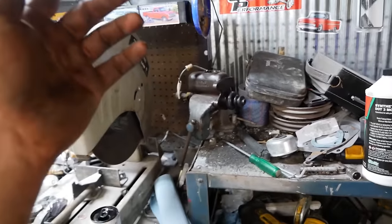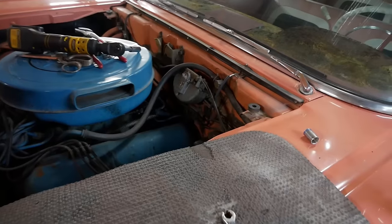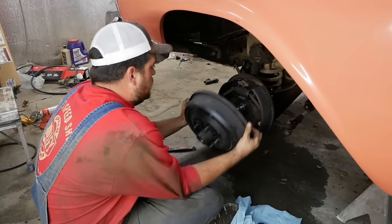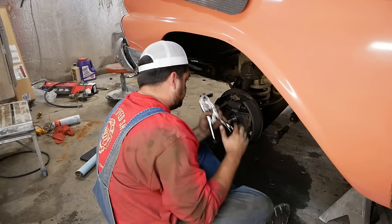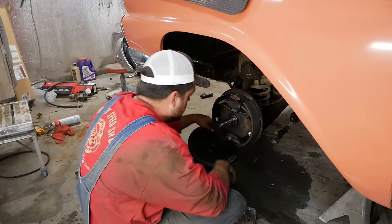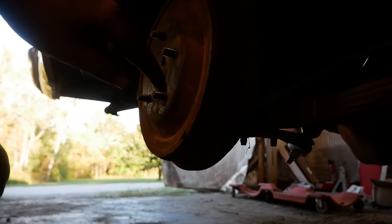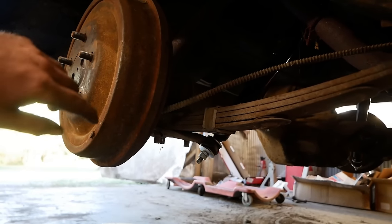But I'm out of brake fluid, so I ran into town and now the master cylinder's back on. Hit the brakes a couple times — it already feels better. Let's check the front brakes and make sure those wheel cylinders still look okay. You guys said these springs go in this upper hole — yeah, they were pretty tight. I think I put them in the wrong spot. Not only was the master cylinder bad, but it was having to work ten times as hard just to push the brakes open. Readjust the brake. I cracked this bleeder and I'll let it gravity bleed — probably the best way since I'm on my own.